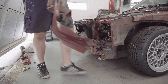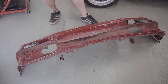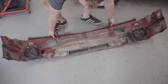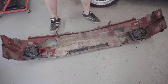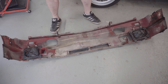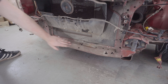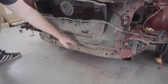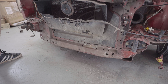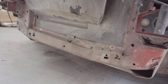There we go, it lifts away. With that off, you can get a better look at this dent here. From the back you can see that it's got quite a crease, but I think with a bit of sensible hammer and dollying you could get that out. It looks like the way they actually fixed it was harder. You can see whatever the hit has gone through to the lower core support and dented it in a bit, but I think I'll be able to straighten that out to a reasonable standard - plus it's well hidden. So I think that's okay. It could have been a lot worse.